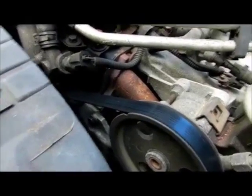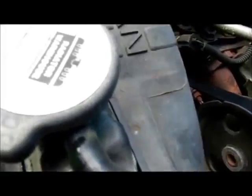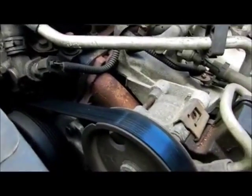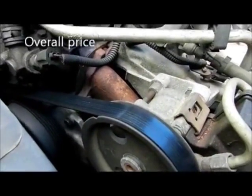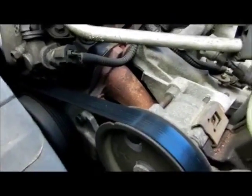I'm getting ready to change out the thermostat. Actually, I'm changing everything out, including the radiator — it's leaking really bad — so I'm going to change out the hoses, the thermostat, the whole thing while I'm doing this. Everything is coming off of eBay. Believe it or not, half the price of the local store. What we're going to do is drain the coolant fluid.